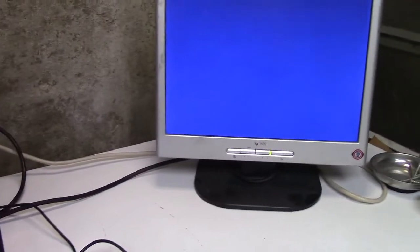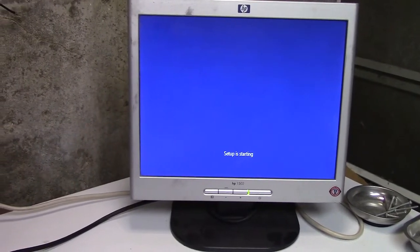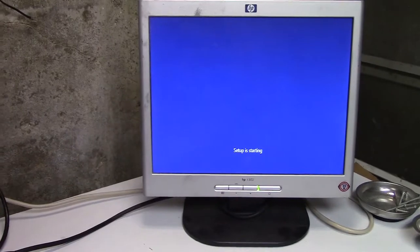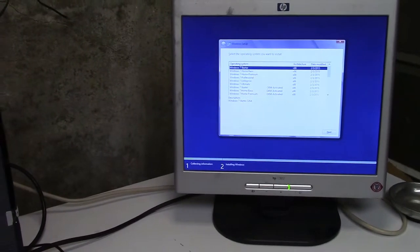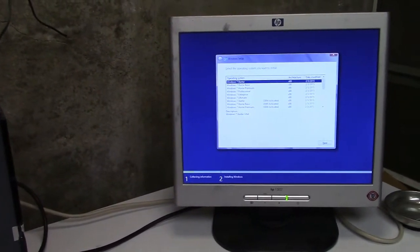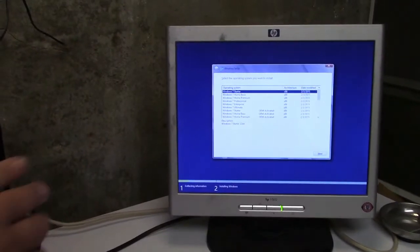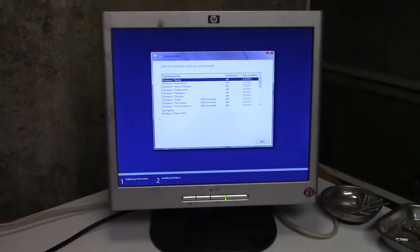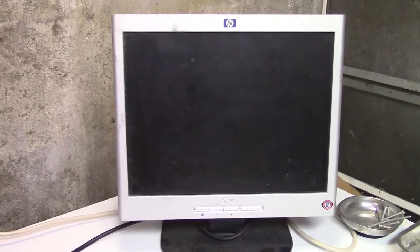Alright, it's been installed. Still barely turning over. We'll go through the out-of-box experience. I don't know what name to give this machine. Oh, no, that was an idiot move on my part. Actually, it didn't. That was really odd, because it booted back off the damn USB. So we'll shut it down again. And I'll unplug the... Well, no, actually, maybe we'll go in the BIOS and reconfigure it to now boot off the hard drive, and leave the drive connected and see what happens.